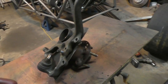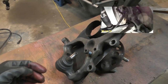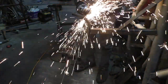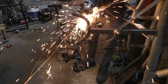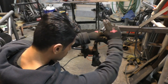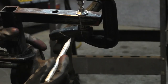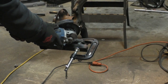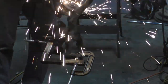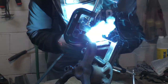To quickly explain how the geometry works on the E55 — that is also a double wishbone suspension, so there's a top control arm that pivots on this ball joint, and then there's a lower control arm, which is actually split into two in this car — something called a virtual pivot. I cut off the top mounting point of the ball joint for the upper control arm, because I was planning to reuse the same attachment point but just relocated to where I needed it. I clamped the mounting point to that position, made sure the measurements were right, then figured out where to cut the spindle in order to weld the two pieces together. After that I did some angle grinding, cut the spindle off, and applied the weld — it was initially a little difficult to get started because the metal was still a little cold.